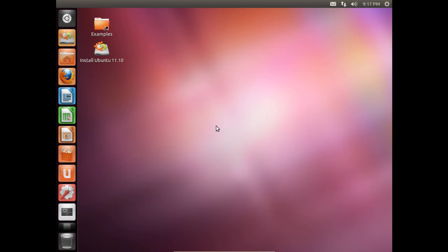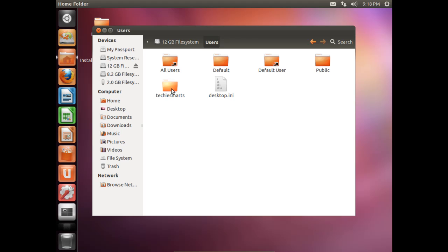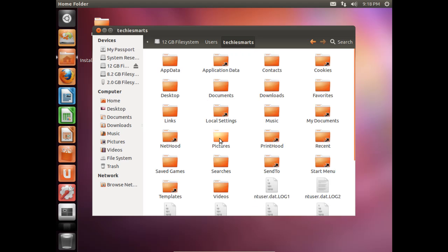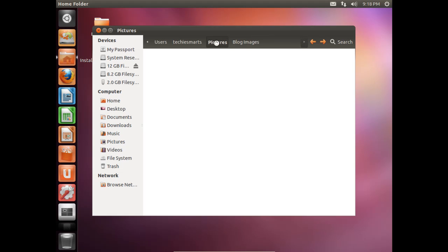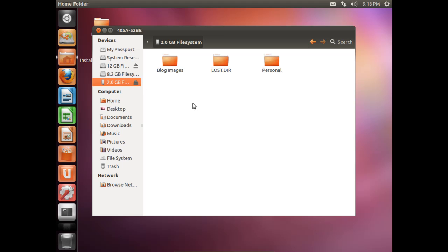Once we get to the desktop, simply make sure your external storage is connected to the computer, whether it's an external hard drive or USB flash drive. You'll notice we have Unity down the left-hand side — this is Ubuntu 11.10. We'll simply launch the file explorer by clicking on the Home Folder icon. You'll notice our other drives and partitions over on the left. This is also detecting a couple of the external hard drives I have connected — that's my Passport hard drive, and down here is the 2GB USB stick connected to the back of the machine. So we just need to go up to our Windows machine partition, and just as we did in Knoppix, navigate to the folder we want to rescue — the Techiesmart user folder, then into Pictures.